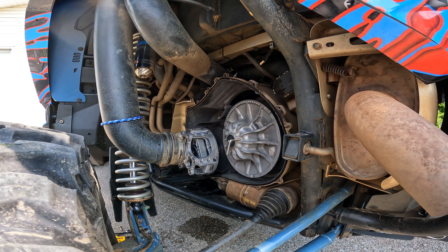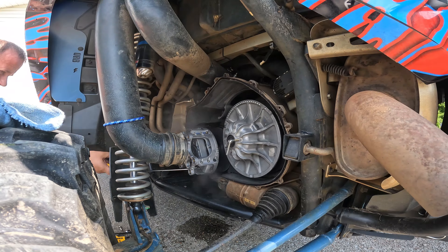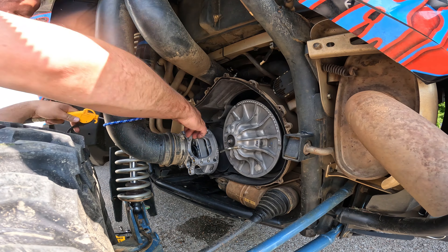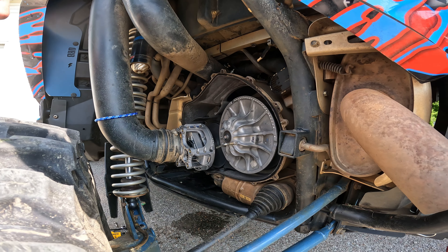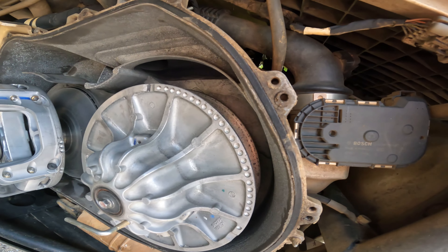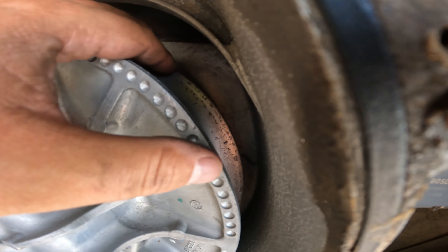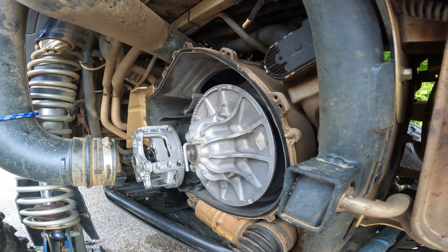We got a little air hose here with a little attachment — let's see what we can get out of here. I'm going to give it a nice wipe down now. They say use alcohol and wipe down these sheaves with a little bit of Scotch-Brite. You can see my secondary's got a lot of stuff built up on the top end here — it's pretty rough on the inside, so I gotta get in there and clean it up pretty good.